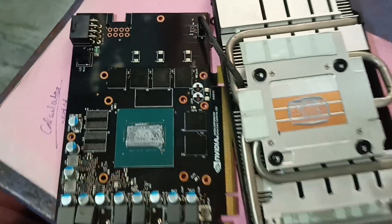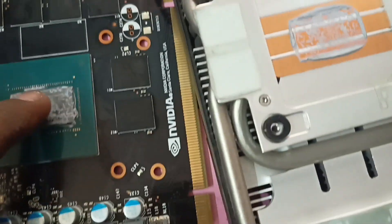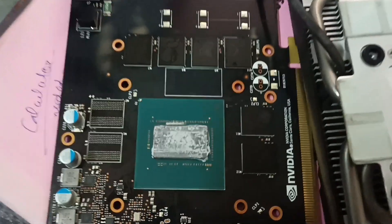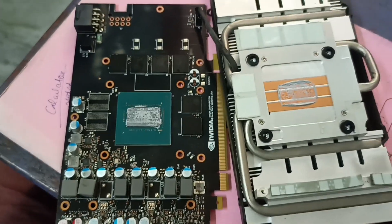This is the inside of the card as you can see. Here is the fan connector. There's no need to open it if you just want to change the thermal paste, as in my case. If you want to open the fans and clean them then you'll have to open that connector. And you can see the thermal paste is crusty here — I'll have to change it now.